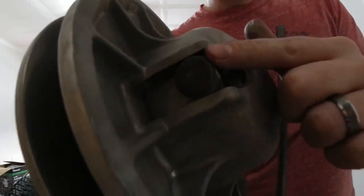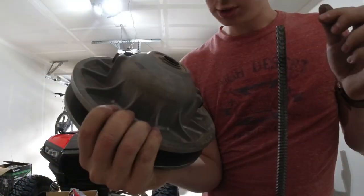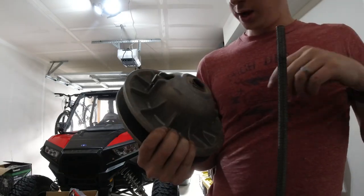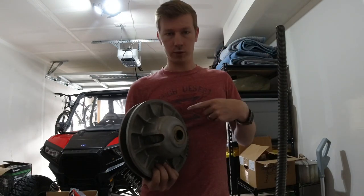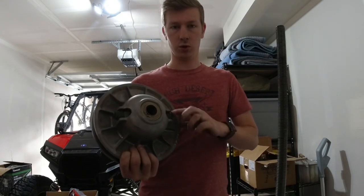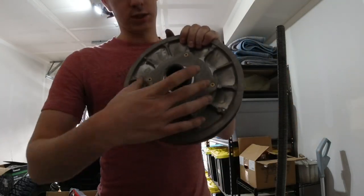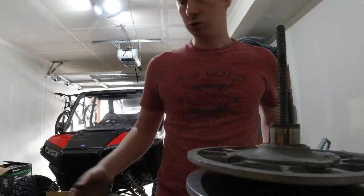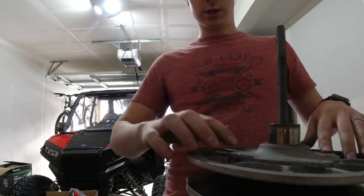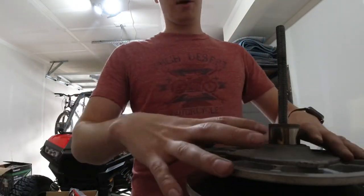On the secondary here, I can immediately see that these rollers have been flattened on one side. I'm going to go ahead and run over to the Polaris dealership and buy some of these — they're actually kind of pricey. There are four rollers total: two on the inside and two on the outside. I need to open it up to see if I need to do all four or just these two external ones. To get in there, we're going to take this plate off — these four screws. It's also a good idea to heat these screws one at a time because they've got some Loctite on them.